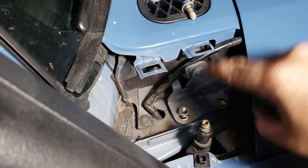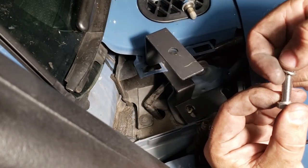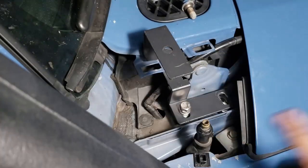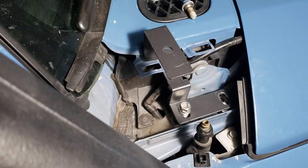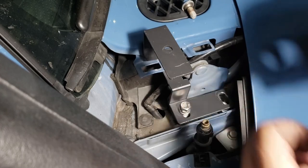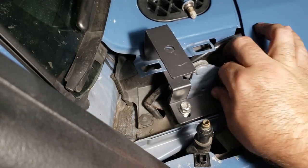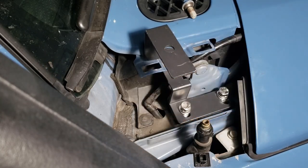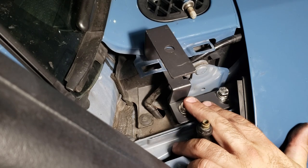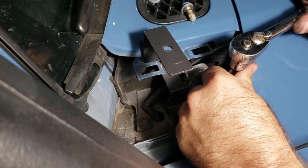Put those nuts over top like so. Take your new bolt, lock washer, then washer, and go through the bracket, through the nut spacer, and through the hood into the car. Do the same on the other side — bolt, lock washer, then washer. Make sure all your parts are stainless steel. This is an off-road vehicle that will get wet, and you don't want rust. Also, once you've confirmed everything test fits, paint this bracket — any unpainted areas you just cut will rust.